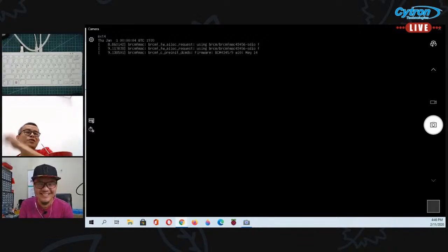So the first priority is the SD card. That is kind of convenient also. You can have two OS. If you don't want to boot from the SD card, you just remove it. But this is quite slow, because I'm using one of the slow drives, I think. If you boot from SSD or M.2, it is quite fast. I just want to show that out of the box it is ready to boot from USB.